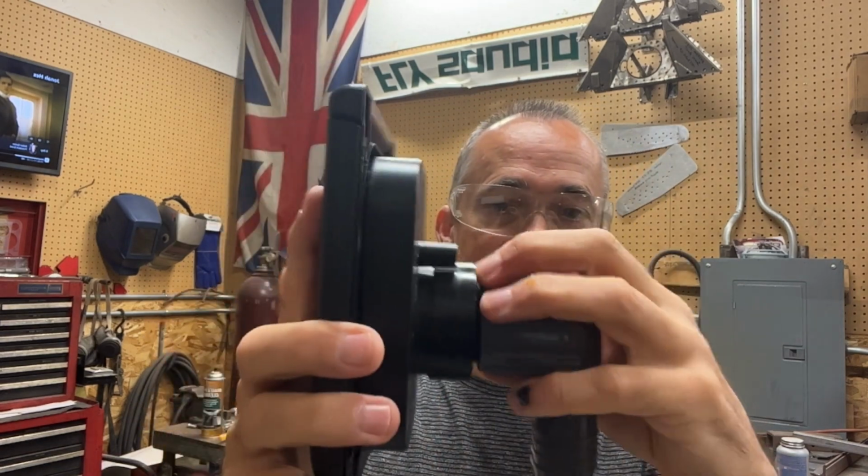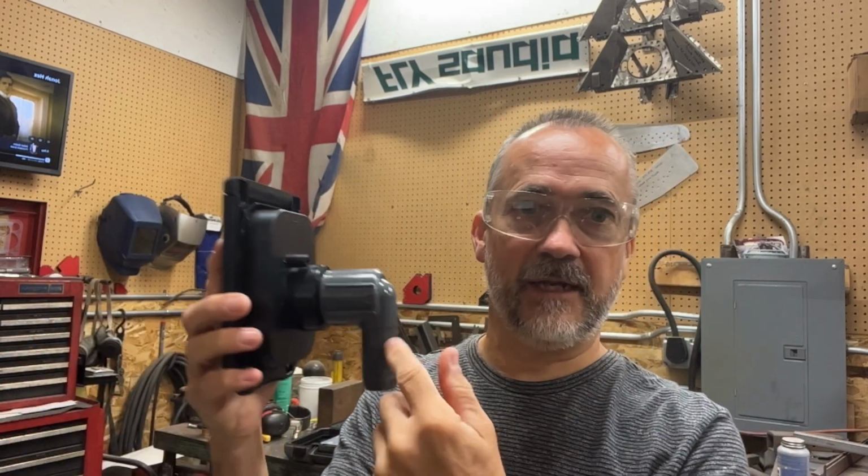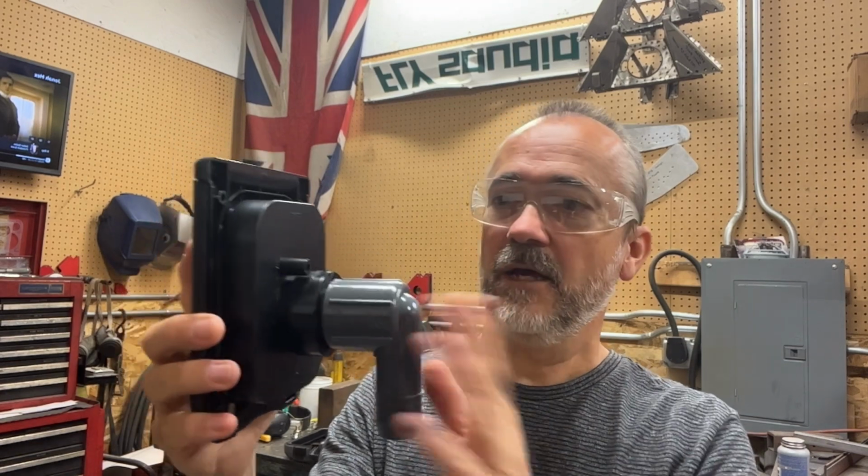I'm going to then epoxy that on there, something like a 2-part epoxy like JB Weld or something to put that on there, and then I can silicone around the edge. That should make that watertight. It should work out just fine. Now I've got the 90 that I need for a straight down hose connection, which will go at the bottom and then to the tank, which will work out better.